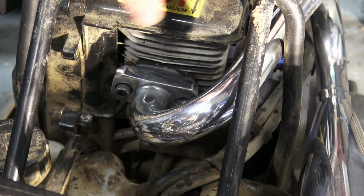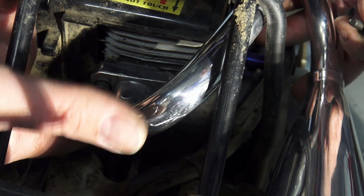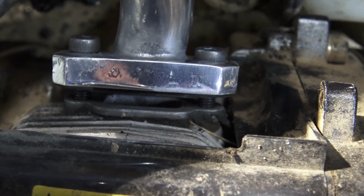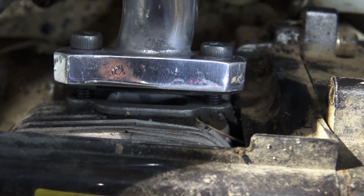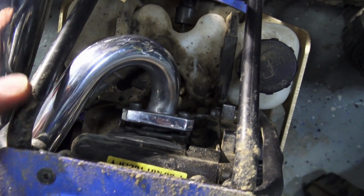And now once you have this side in and it's through the gasket, it'll help us line it up. So you just take your finger on the bottom side here, get that gasket back up because it fell down. I'll find it first. There we go. And we can start getting this other bolt through. You have both bolts through and you think you're through the gasket also, it's a good idea to leave it like this, a little bit loose, and do a visual check and make sure that you're actually in there. And then we can commence with snugging them up, and then we'll go back over here to the bracket and we'll install the bracket. Once that's on there and loose but aligned a little bit with the shock tower, then we can come over here and finish tightening.